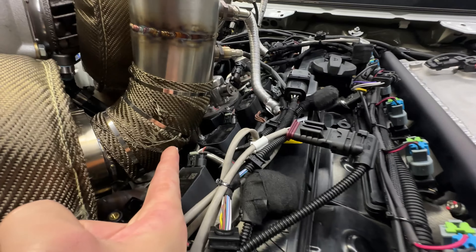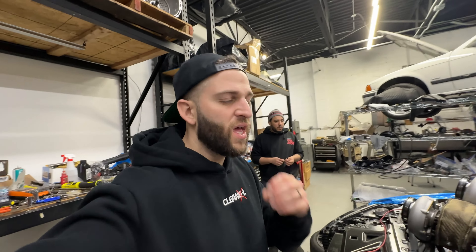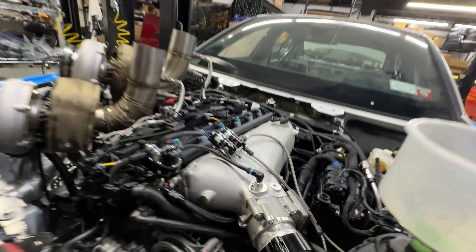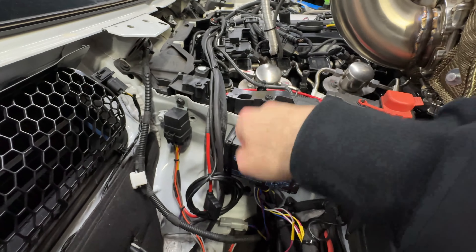We've got heat shields on the turbo, a double-layer heat blanket to protect things. Even though it looks tight, it is tight. The up pipes are 100% made — three and a half inch massive pipes. I got velocity stacks for the car that need to go on to look a bit cooler. Nelson extended the wires so we have a coolant level sensor, dial, and fuel pressure. He flushed the fuel system already so it's all cleaned out of any gunk or dust. There are so many small details — finding fittings to get from one thing to another, drilling, modifying — all these little things take a considerable amount of time. We've got a random hose for the crankcase breather; I ordered a fitting to add another breather because when you're making 1,300 to 1,400 horsepower you're going to have crankcase pressure that needs to be relieved.